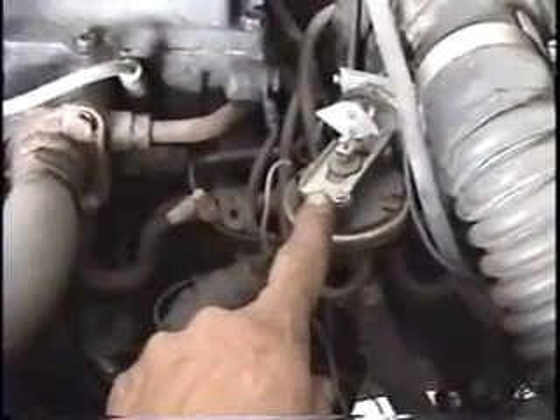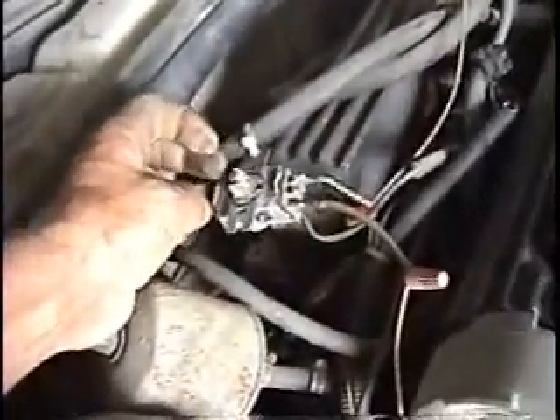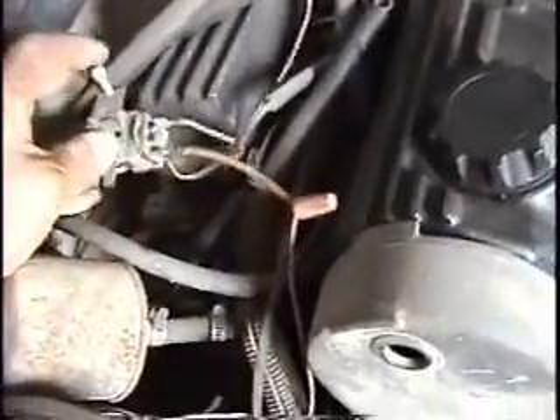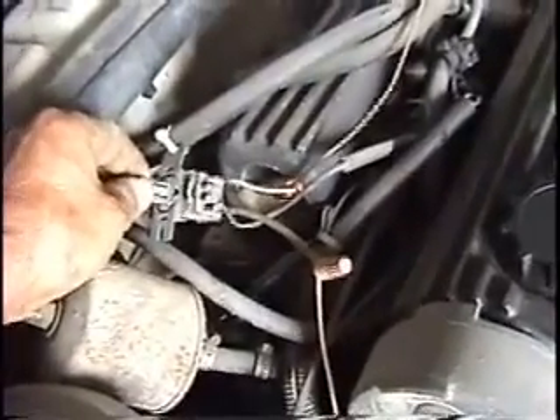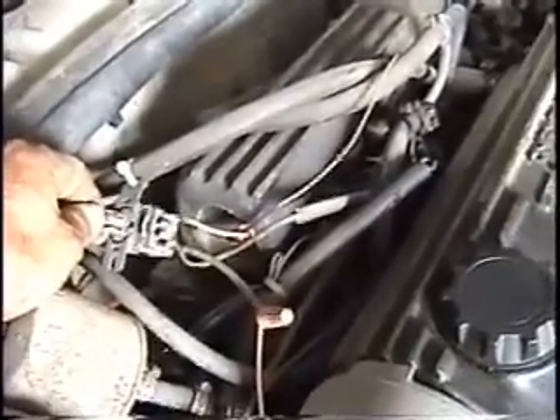This Inglis washing machine pressure fill switch is the thing that senses the pressure in the manifold so it can turn on these two little fans. Here is my Inglis cold spot full-size frost-free fridge thermostat, modified with the pressure sensing tube hooked up to manifold pressure, so I can adjust my wastegate delay system. I can set it for anything from 7 pounds to 16 pounds to delay my wastegate turning on to the last minute — other cars gradually turn the wastegate on while accelerating, which loses the kick in the pants that this car has.